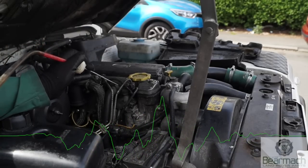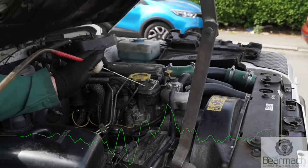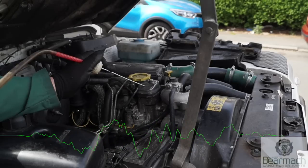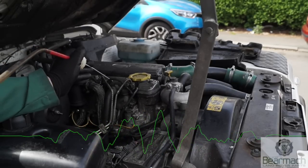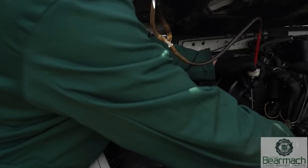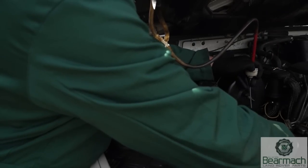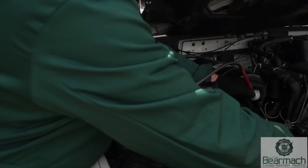The bonus with using a stethoscope is that not only can you check your engine for tapping noises, you can also check other casings for bearing rumbles and dodgy gears. So have this in mind next time you ask about a noisy component. You can have hours of fun with a stethoscope and it's not an expensive tool — you're looking at £5 to about £15. The investment is worthwhile especially when you find a noise you can't locate from just standing there listening to the engine. Get into it because it will point you in the right direction.